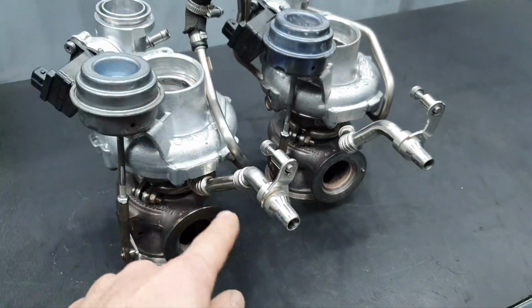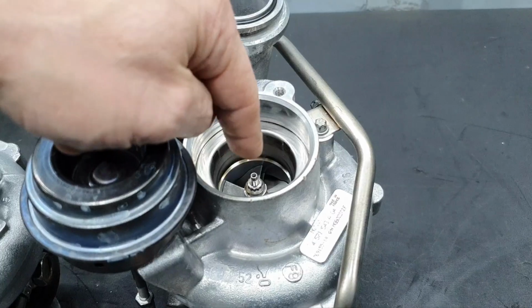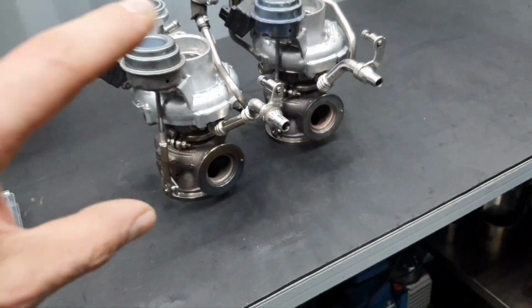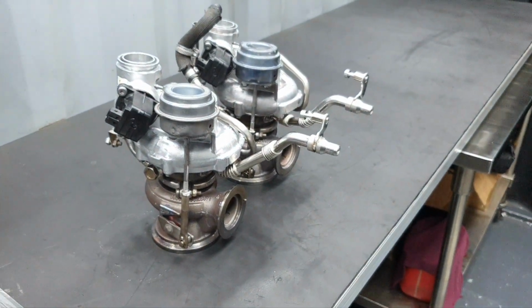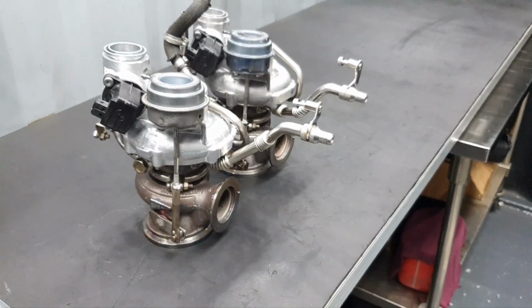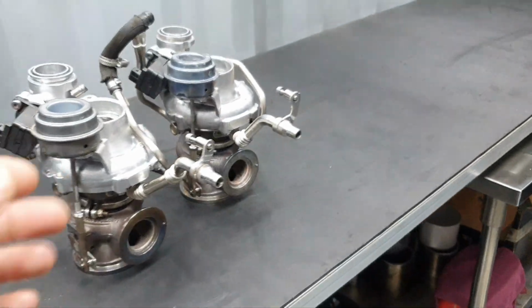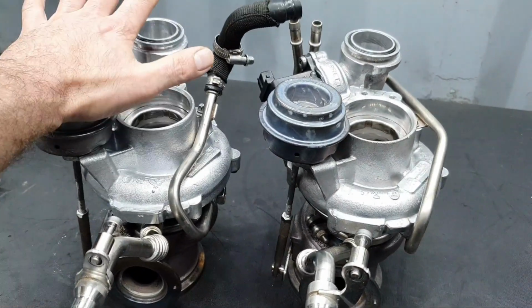Now, the owner knows that before, when it was out of balance, the turbocharger had a problem with the compressor wheel. When he was boosting, it made one whining sound from the turbo. I need your ears open, so if you hear any sound, don't push the car. We have to send the turbos for balancing, obviously. Alright, if it's running fine, we're going to see about that. How long is it going to last?